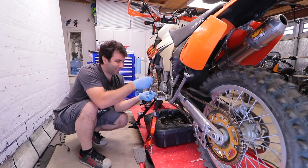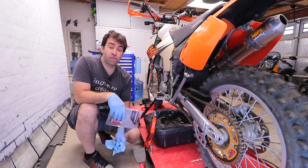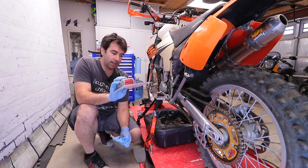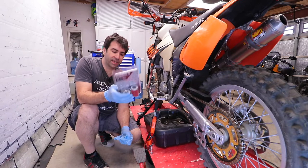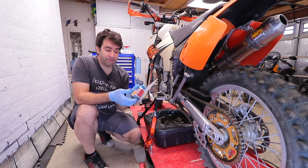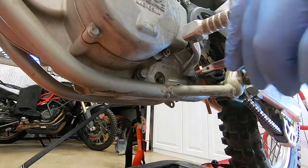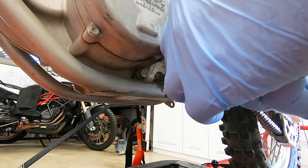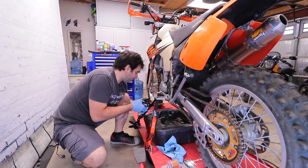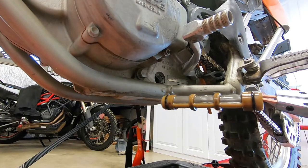They were definitely over-torqued. I actually got the KTM service kit, which in theory comes with all the filters, all the screen filters, and o-rings as well. Time to get in there and grab the screen filter. It doesn't look half bad — to err on the side of safety I'm just going to leave it here for now and decide what to do with it later.